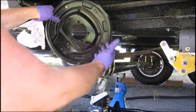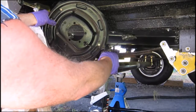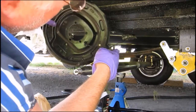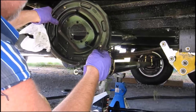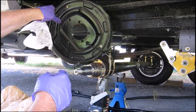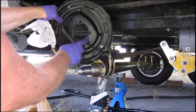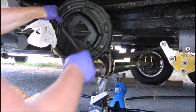When you pull this assembly out, you'll notice that the wires are attached here and they also go into the axle — I'm assuming all the way over to the other side — and they also engage up and over to the trailer harness in some fashion. In case you want to reuse this assembly later since it's still good, you want to leave some wire. So I'm going to cut it here and leave enough wire where I can splice the new hub into it right there.